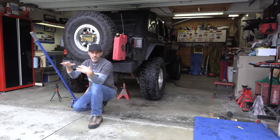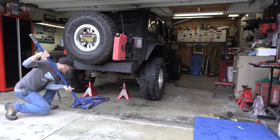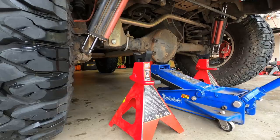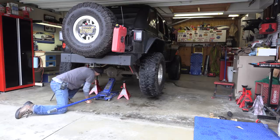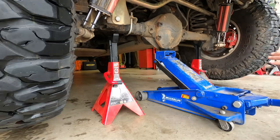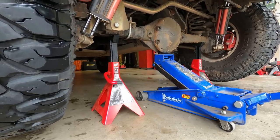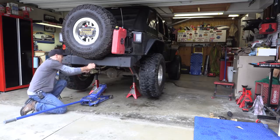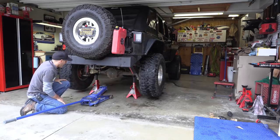To continue the theme from the first video where I showed you how to jack up the front of the Jeep and secure it, I'm going to go ahead and do the rear of the Jeep — it's much easier, just like everything on the install back here. I go right to the center of the differential housing and just lift the Jeep to a height I like, get under here, put my jack stands in place, make sure they're at equal height, and down you go. I always shake the Jeep to make sure it's not going anywhere. If you can't shake your Jeep on your jack stands, you have no business being under there. Now let's pull the tire off and I'll show you the bump stops in the rear.